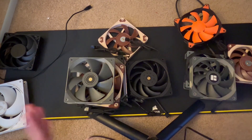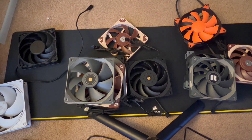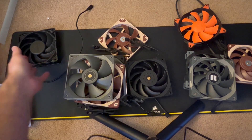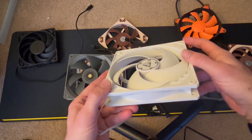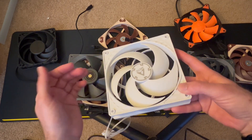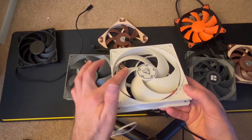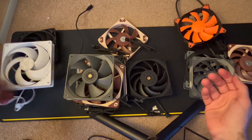RPM matters a lot. This fan becomes more or less not noisy at approximately 1,400 RPM. But this other fan I think is noisy because of the shape — there's so much surface area really close to the front of the hub. The shape itself could make a lot of noise because of the blade count. So a lot of area is close to the front of the fan or close to the grill.